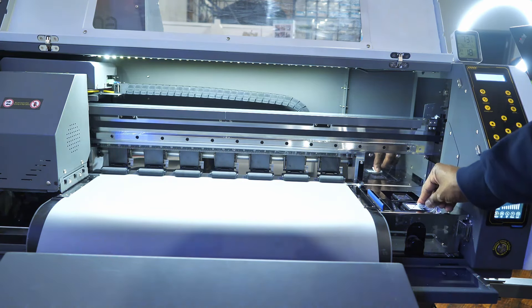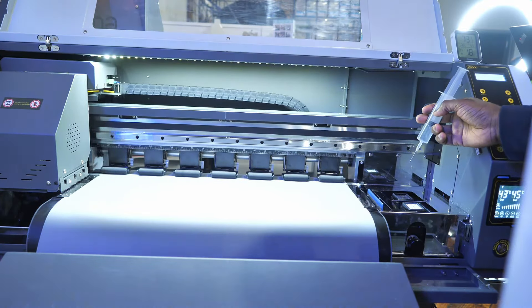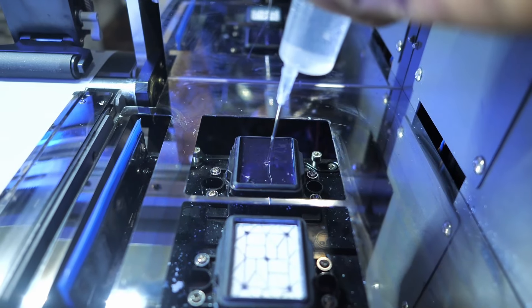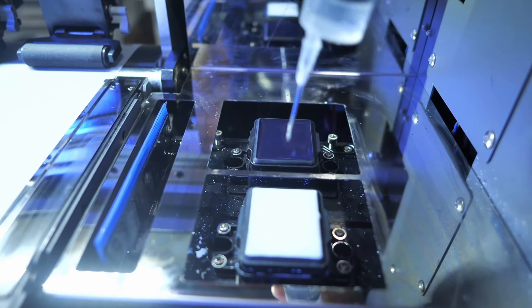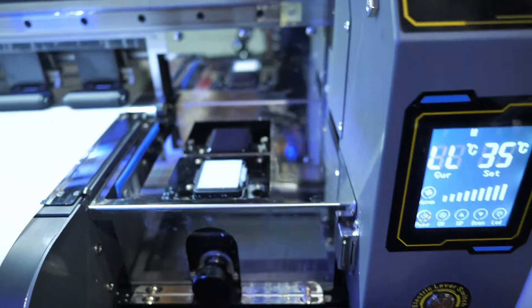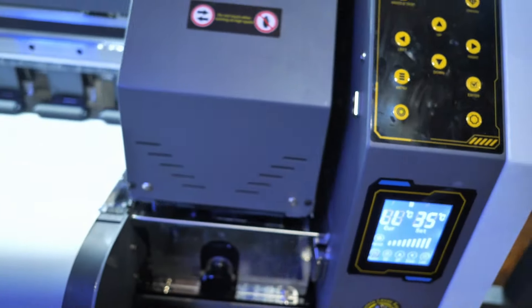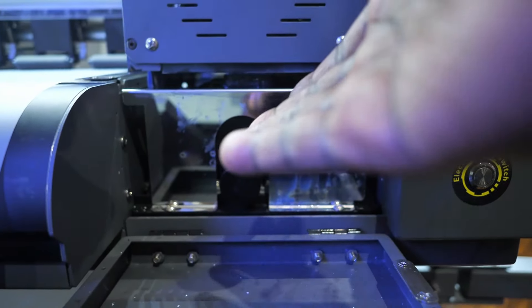Now that everything is clean, I'm going to get my syringe with cleaning solution — let me get a close-up so you can see. I'm just going to squirt some cleaning solution in here, then put some in this channel. Now when the printhead comes back it'll be sitting in cleaning solution all night long. They say it's in the instructions, but something this important you should really be told upfront. Press enter — now the maintenance station comes up and the printhead is sitting in cleaning solution. Can't get clogged — no way.